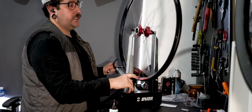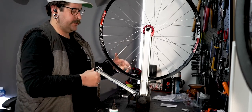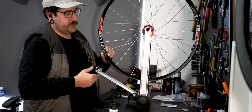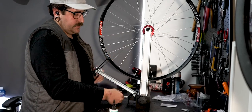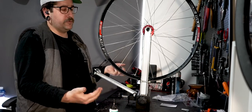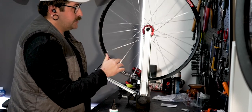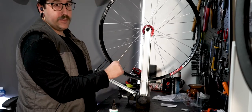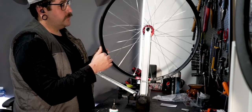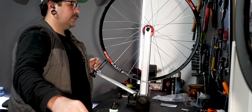It's also got a bit of a hop in it. This is where we start to tension up and get all the spokes into tension. While doing that I like to true it both laterally and vertically just to make sure everything's alright. I line my truing stand up — not as important at the start, but I like to do it this way so you're working with looser spokes at the beginning rather than getting to the end and working under full tension. As usual I find that the valve hole is very important — always start from the valve hole and finish at the valve hole.